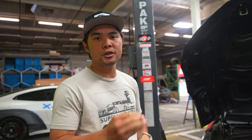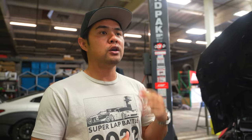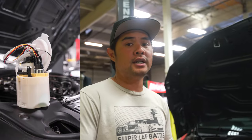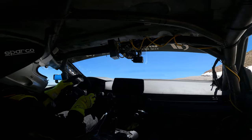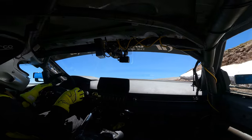All right, so the first thing James is tackling right now is obviously the CSF intake manifold, but the biggest key to doing a stock turbo setup with E50 is going to be the low pressure fuel pump. We found out on our Supra, the most reliable and the most consistent fuel pump setup for the in-tank low pressure is the PFS upgraded Stage 3 fuel pump. They all provide enough volume, but that pump literally does not have any fuel starvation issues.